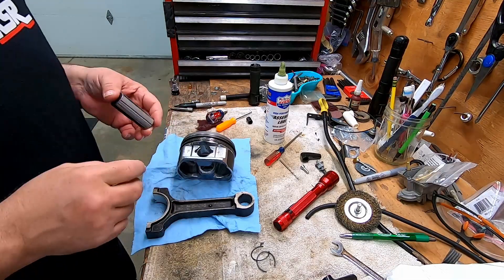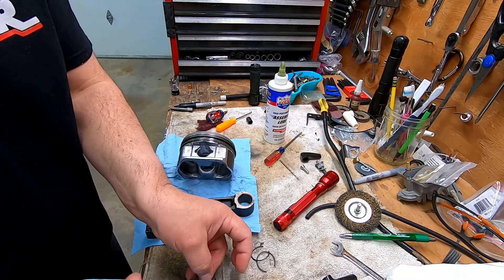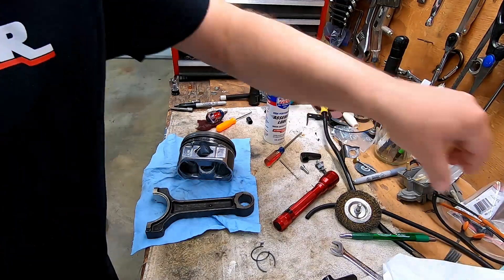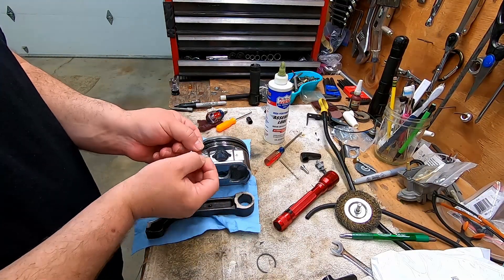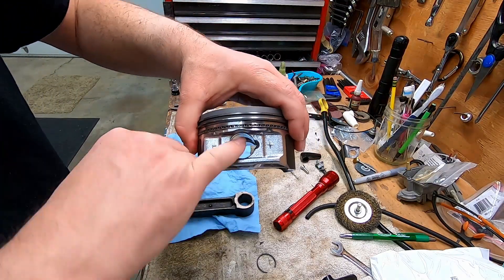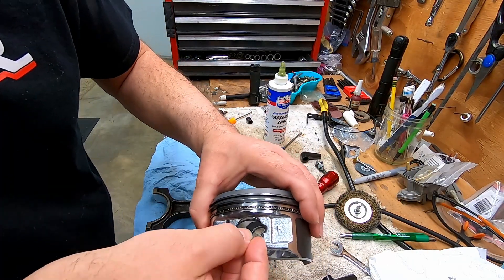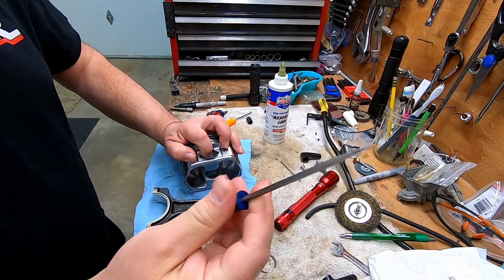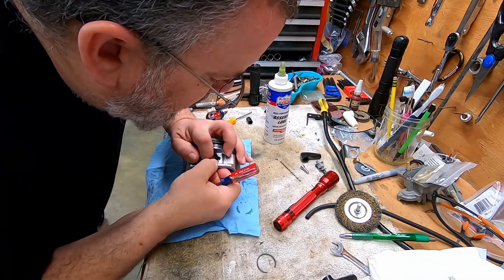We're going to put a little bit of assembly fluid on the wrist pin and the bushing. If you have the non-floating rods, you're probably going to want to get the machine shop to put your rods and pistons together — they'll use a heater or furnace to heat the rod up so the pin can be slid in. I like to start the first lock without the rod even in there, putting them in with the opening spanning across the little scallops. I use a flat bladed screwdriver and can usually get the lock in without a single scratch.